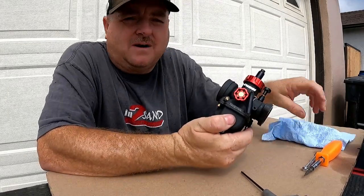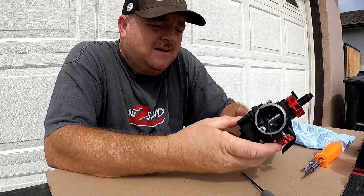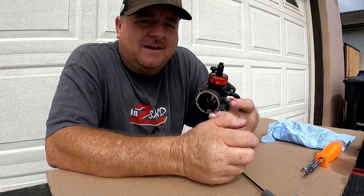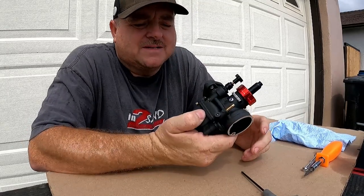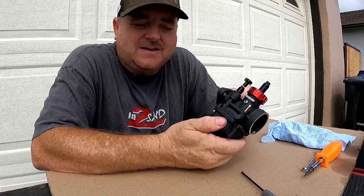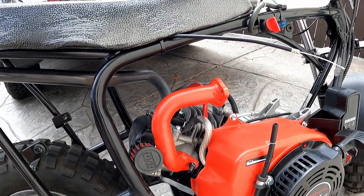We've got the Newbie carburetor off of Max. I had a request from Kentucky Fried Fixin to take a closer look at it. It's a really nice carburetor — I like the colors, the matte black look and the red on top. It's just an all-around nice looking carburetor. I'm not gonna disassemble it down to each piece, but I'm gonna figure out the jets. As you saw on that quick ride, it's got a really bad flat spot, and when I pull the choke that flat spot goes away. It needs more fuel — that's a big intake runner and I think it leans it out.